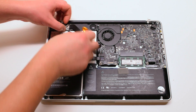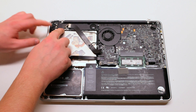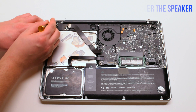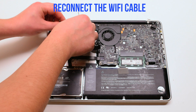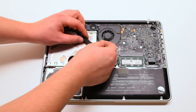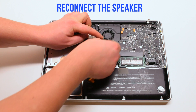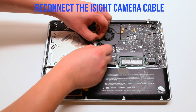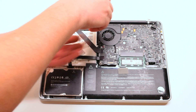Trace out the camera cable and tuck it in along the speaker. Make sure all the antenna cables are tucked in underneath the speaker bracket. Reconnect the Wi-Fi cable — in this example the Wi-Fi cable popped out. Reconnect the other end of the Wi-Fi cable to the logic board. Reconnect the speaker. You can now reconnect the iSight camera cable. Reconnect the last Phillips head screw on the right side of the speaker.